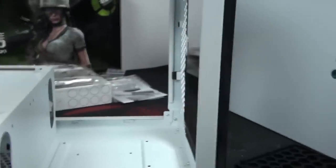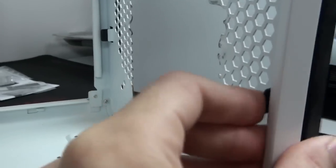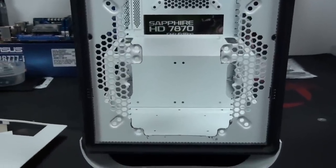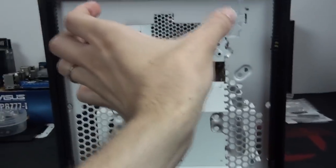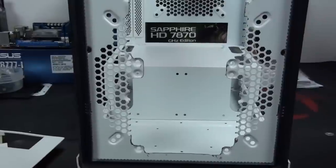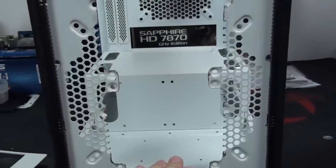The remaining black strip I've left around the outside of the front panel clips to the case with four clips, so that works out nicely. The next thing I needed to do was cut a panel to fit inside of this black strip, and I decided to use smoked plexi. I've also cut a piece out of the honeycomb in the front panel of the case, going around and leaving behind the radiator mounting holes.